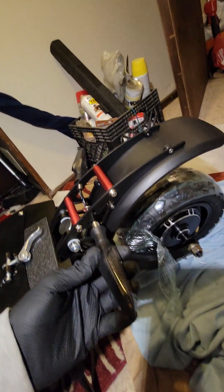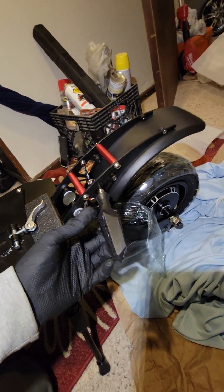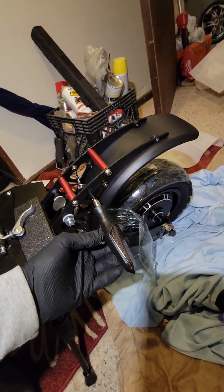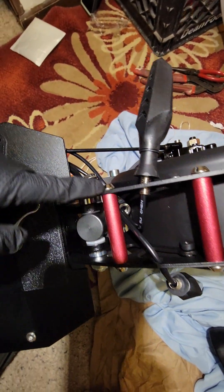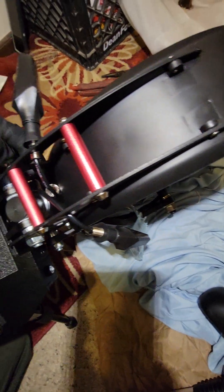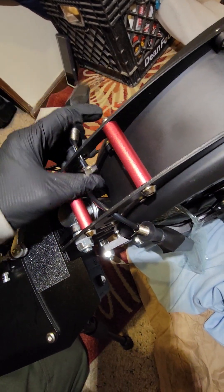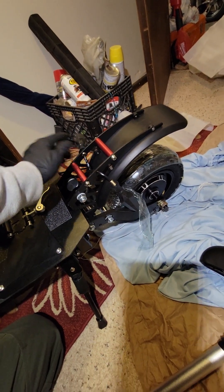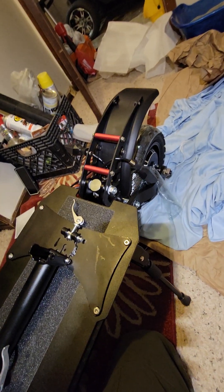These are little blinkers — some of these don't even come with blinkers. I'll tell you guys what model I bought and how I got a deal on it. It ships from America, from the United States. So these here are just threads right here, and the bolts are sliding down — here's the connector bolts right there. Just thread those up through there and screw them on, push these through. Some of this stuff you want to use Loctite on — use the releasable Loctite. Some things you don't, it depends on what it is.